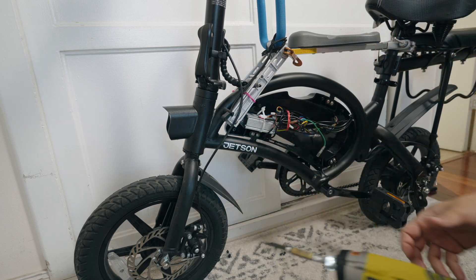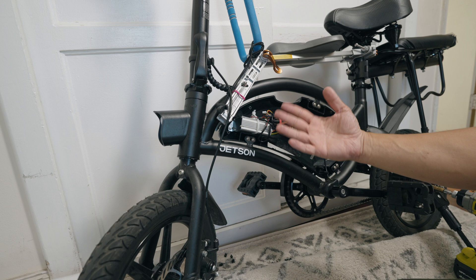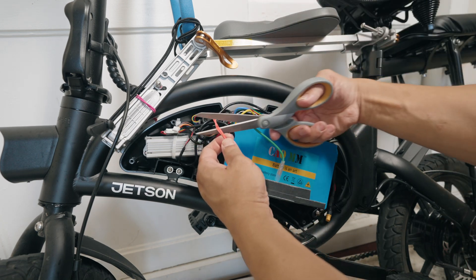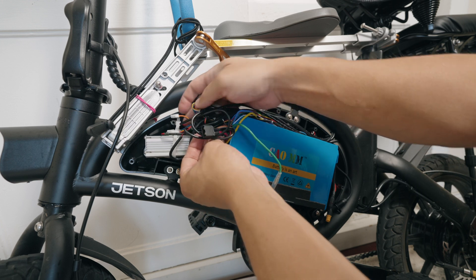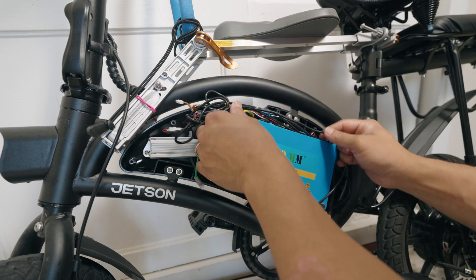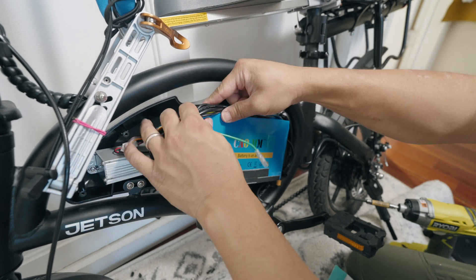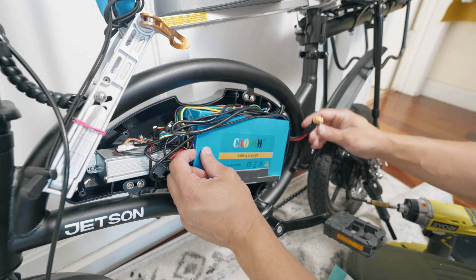I'll just leave it a little loose right now, just to see how the battery fits in here. I'm going to lean the bike back because I want the battery to fall forward rather than out. The fit is tighter than I expected. There we go. So I am going to route this over the top because this is the pedal assist cable. I'm going to have to cut this off as well because this wire is stuck there. So what we're going to do is lay as many cables flat as possible on the top. There's barely any room, but it's not going to pinch because the weight is on the bottom. I still have the power connection to do, so let's do the power before I forget.